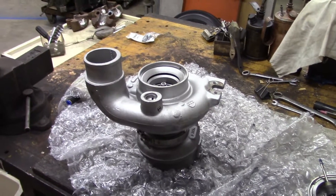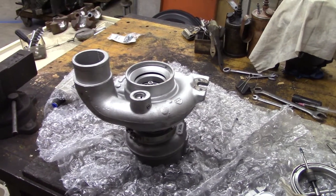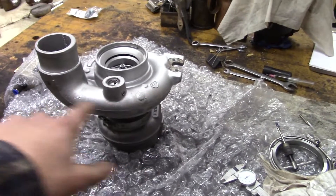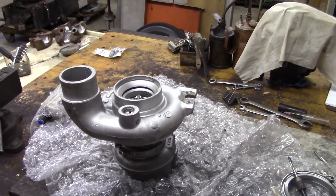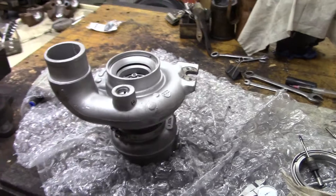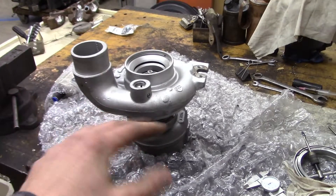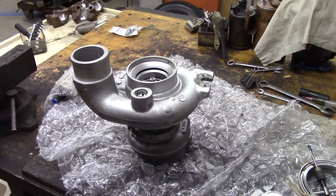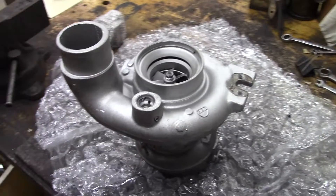This is a remanufactured turbo that I got off of eBay. There's a bunch of sellers selling these turbos on there and it seems good. It's kind of hosed with some ugly silver paint — I thought it was just bead blasted, but it's silver paint. The bearings seem nice and tight, that's all been rebuilt. I'm a little disappointed that this particular seller bead blasted everything to clean it, but there was leftover glass bead everywhere all over it. You touch it and you're all sandy feeling, and I don't think glass bead is a good thing to have around a turbo. So I blew it all off with compressed air.